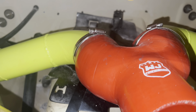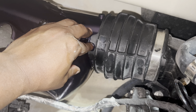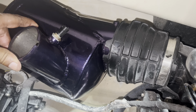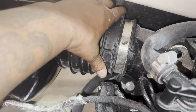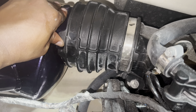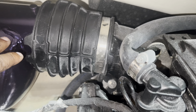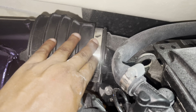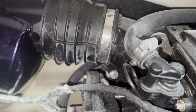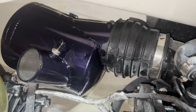We got everything buttoned up in here, all tightened down. Here's the custom water box — everybody thinks this line here, you can't move the water box to tilt towards the exhaust, but you can. This is not a set setting — you can move this any way you want. Just untighten this and you can rotate the notch anywhere you want it to go. Once you get your water box lined up with the pipe, move the notch. Everybody gets scared like 'oh my god the notch is not in the right spot' — that doesn't matter, that's just showing you where OEM was. For aftermarket exhaust, undo this clamp, twist it anywhere you want the notch to be, line up your water box and tighten it right back down.